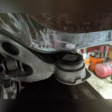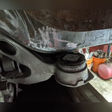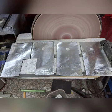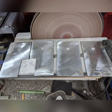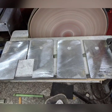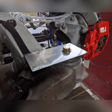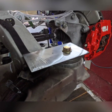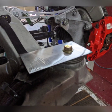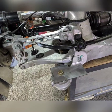The next problem was how to attach the car to the motor — the car is going to be sitting on top of it. The best idea I had was to have it rest on the frame, so I made plates out of thin material so I could shape them more easily. I bolted them into place and trimmed them for clearance. The rears were fine as a simple rectangle, but the front needed a notch for the lower control arm mounting point.